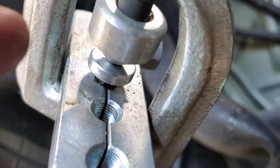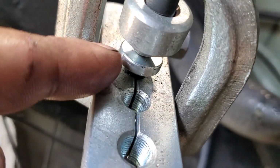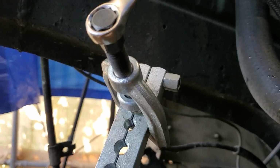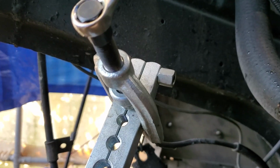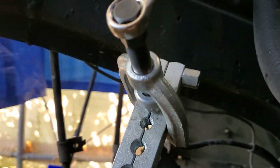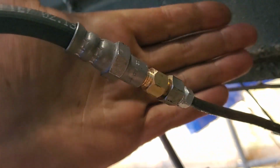This will create a bubble flare, and then if you were to use this and then you use the cone, that creates a double bubble flare. Pain in my ass. Why can't we just have one universal flare? But yeah, so I'm gonna undo that before I mess that up, and then do that. So let's do that. All right, so there it is. Whether it works yet, we will find out.